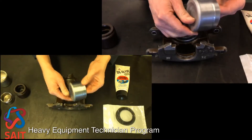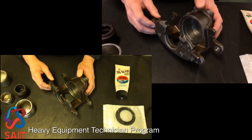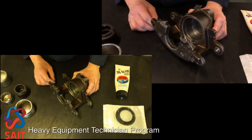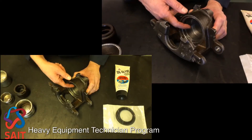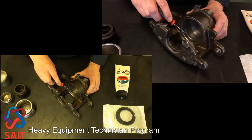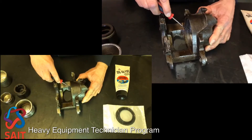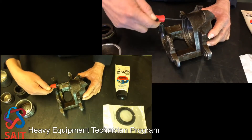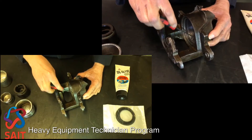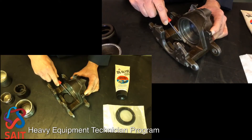This is the one we're going to deal with here, and it looks pretty good — we could put it back in. The machining on the bore of the caliper is not that precise, but you still want to have a look at it and make sure it's in good shape inside. The other thing that's really important to pay attention to is the O-ring groove — that's the groove right there where the square cut ring would fit into. We want to make sure that is clean with no corrosion in the bottom. You could run an O-ring pick around there just to make sure there's nothing in there, and also all the way around the whole thing because this is where the dust boot is going to sit into.